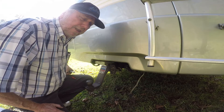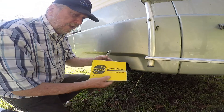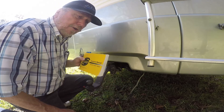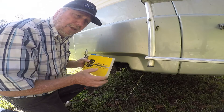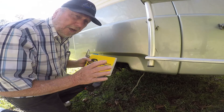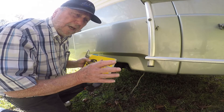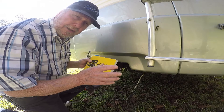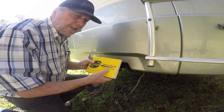Let's go to the front of the vehicle. With the manual — you're going to need the chassis manual. The fuses you're looking for are going to be under the dash and in the engine compartment. It's not the coach fuses. The coach itself has a fuse panel, an electrical panel that has fuses in them. You don't need to worry about that — that's strictly for the coach and not the chassis.